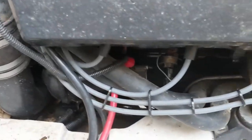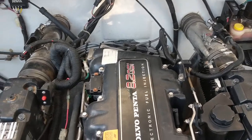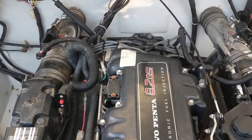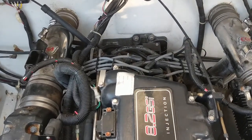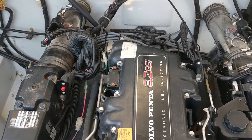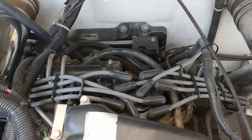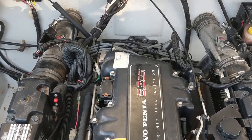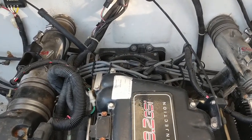After you finish, if you are close to the water, go ahead and throw it in and make sure everything works correctly. If not, if you have some muffs, put them on the outdrives and make sure everything is functioning correctly. One thing I've run into on a previous boat is a previous owner who didn't put the right wires in the right spot — so some of them were too tight, some of them too loose. If you run into that, you may have to run each wire by hand and make sure it's the right length and the correct one in the right spot. Hopefully they're already in the right place and you can just measure them out, compare against the new ones, and get them all replaced. I hope this video was helpful. All in all, including taking this video, this took maybe 40 minutes. Without the video, probably about a 25 to 30 minute job. Good luck with yours — comment down below if you have any questions and make sure to subscribe for more videos like this. Thanks for watching.